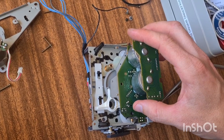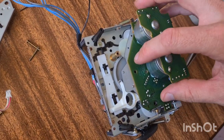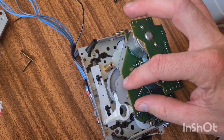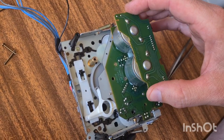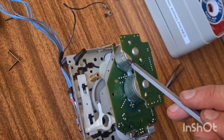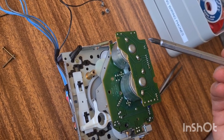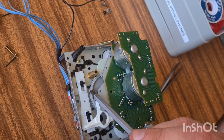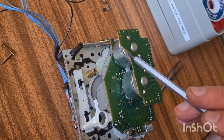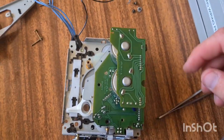Be very gentle with the switches on the top here for your tape type. They can be easily tested, and if very defective it's basically a dead deck — it just won't play anything. My issue was, very strangely, that this mode select motor was just doing this clacking noise — flipping backwards and forwards. Upon looking at it, it looked like the gears were not meshing properly and it was catching. But if you put your fingers on it, the motor itself was flicking backwards and forwards really quickly, doing that as soon as you power it on.